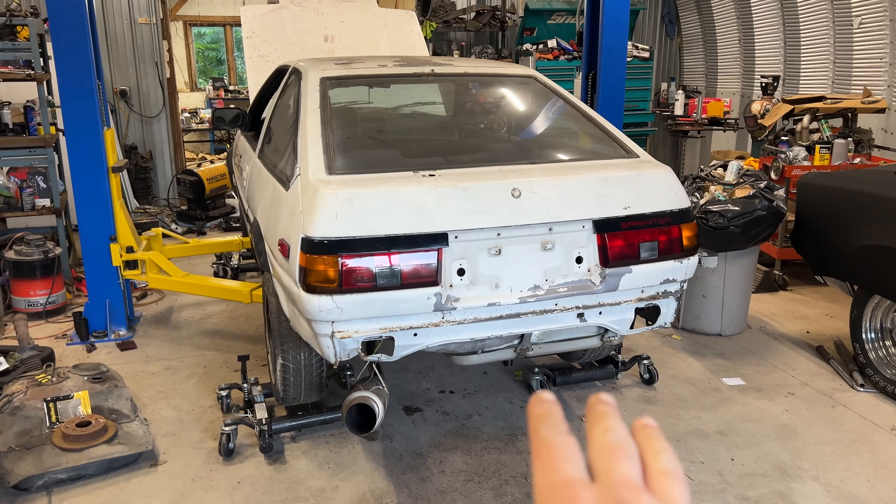Jason and I did a bunch of work on this last week to try and get it to drive. Unfortunately, we ran into a little bit of an issue where the crank position sensor is losing RPM for some reason. Got a couple things I want to try first, and then as long as that goes good, we should be able to drive it. I got to verify that the sensor is the correct distance and a couple things like that, and then it might just be a setting in the Haltech. We'll figure that out, but hopefully we drive it today.